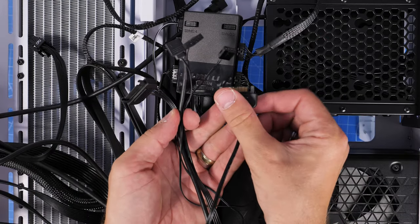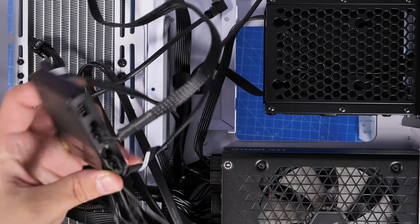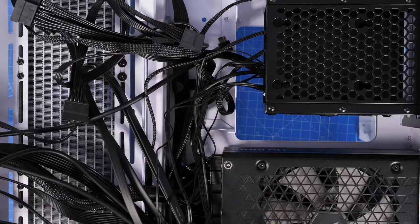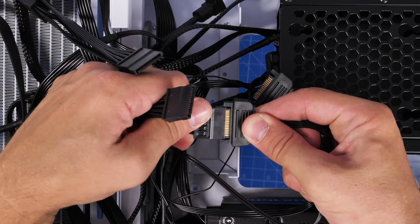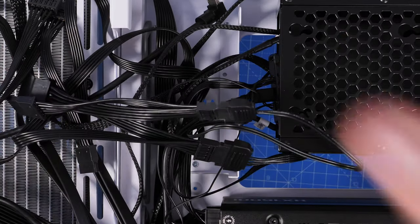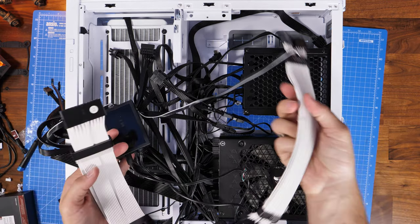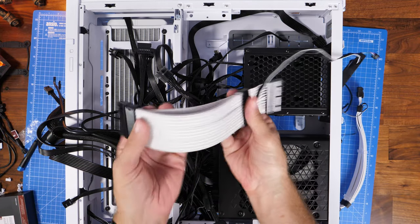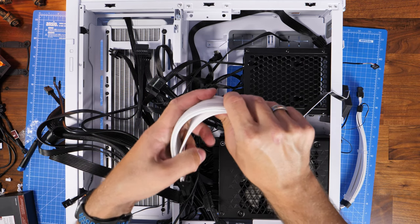This control box has a variety of cable connections including SATA power, USB, RGB, and PWM fan power control. I have gone into a bit more depth on this connection and how you set it up in separate videos linked in the description. Essentially you need to make sure it's connected up to the SATA power — those flat connections I showed you earlier for the PSU. There are two coming out of this controller alone. You're going to need another controller for the RGB cables as well — these are the Strimmers, V2 Strimmers, with another control box. I've got one for the 24-pin and then one connection with two connectors for my graphics card, running through to the front and connecting up to that 24-pin power cable.